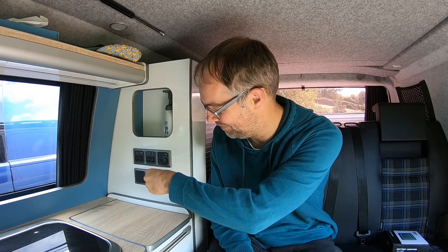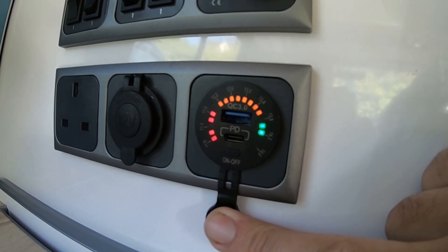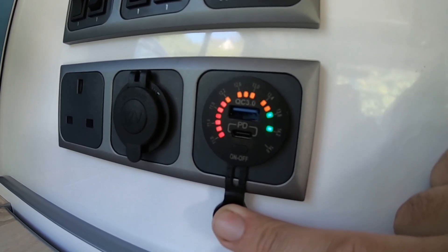One of the things that we have a problem with in this van — it's fantastic in terms of its off-grid capabilities, we've got solar on the roof, we've got a 12 volt fridge in the van so we can keep everything cool — but one thing we're never quite sure about is exactly how depleted our batteries are. We do have one of these volt meters, and it says at the moment 14.2 volts. What that's telling me is the batteries are probably full and the solar is probably trying to charge the battery, but apart from that I don't know whether or not that battery is 100% charged.